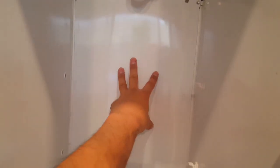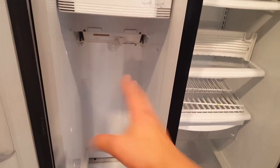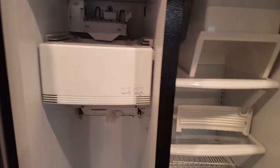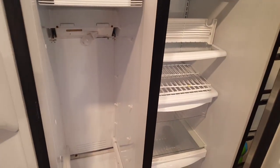What happened was I knew something was wrong because the whole panel right here was full of frost — ice covered. When you open the panel and it's icy, you know the inside was already full of ice, which restricts the air from going up. Another symptom: if your ice cream is melting, that means the heater isn't working properly, because once those coils get full of ice the efficiency drops tremendously and your ice maker starts melting too — it's just a domino effect.